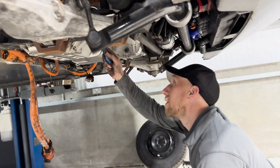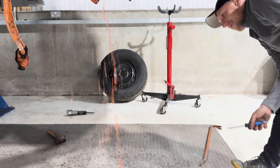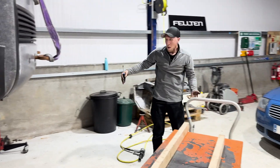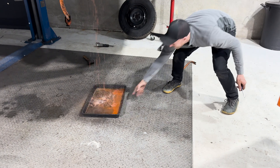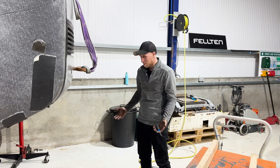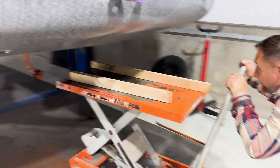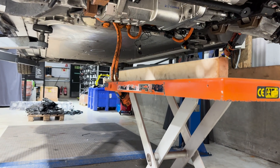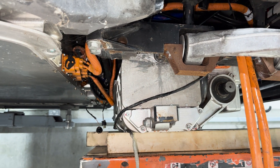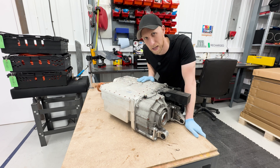That's how I expected a drive shaft to come out. It's like iron brew in there. Now we've got this drive unit out of the van, we're going to start stripping it apart and see what secrets it has hidden inside. I'm going to start with the inverter cover — I'm presuming it's the inverter cover because there are some big DC lines going in here and I don't see where the AC lines go. I'm hoping in here we can see some rather clever power electronics.